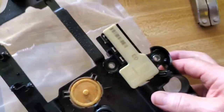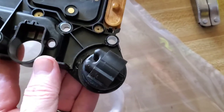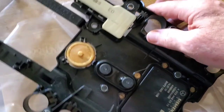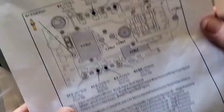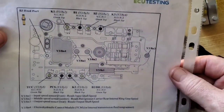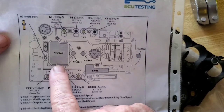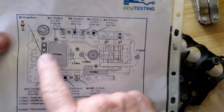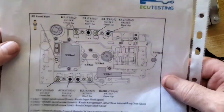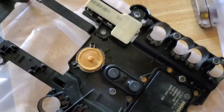I'm pleasantly surprised — I suddenly feel like this was a good choice because they fixed this plug way better than I would have been able to do here, so that's a big win. They also sent along a nice little diagram that shows where each of those items are located — like when it says Y3/8 and Y4, that's actually that component right there. It shows the exact location of all those different components named in the fault codes. Pretty nice.